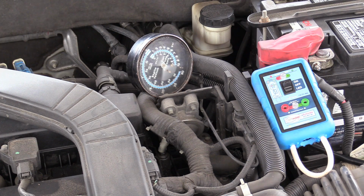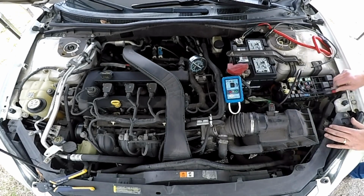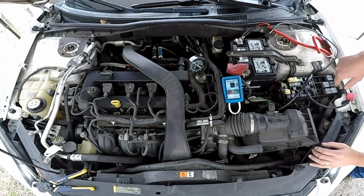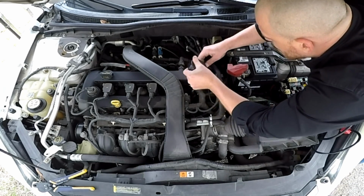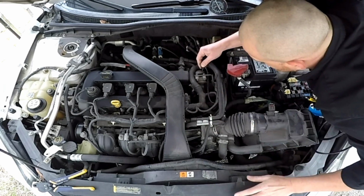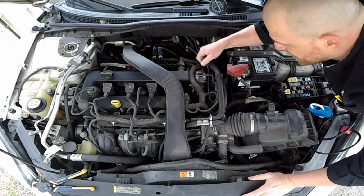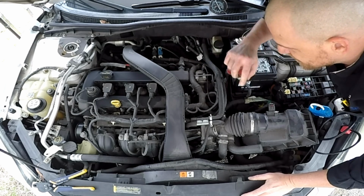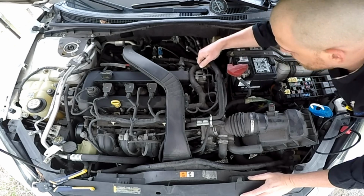Okay, you know what? Hold on. I need to change direction again. Just because I have this window of opportunity, I put the relay back in. This is not in the equation anymore. What I want to do, because now I'm seeing vacuum here, is I'm going to start it and then I'm going to pull this off when I hear the pump running, because I want to hear a pitch change. If this doesn't change pitch, that means my diverter's stuck shut. Okay, so I'm going to try it.